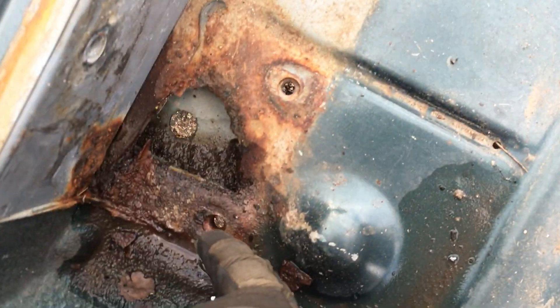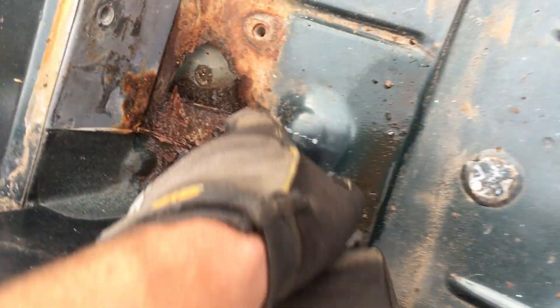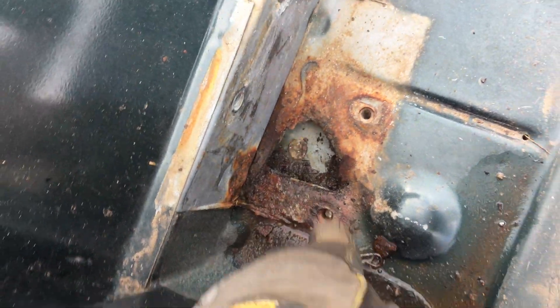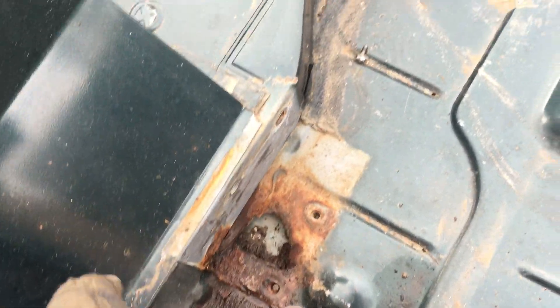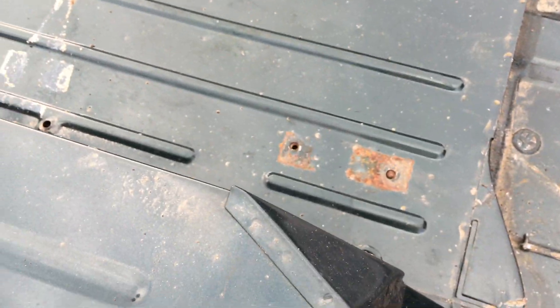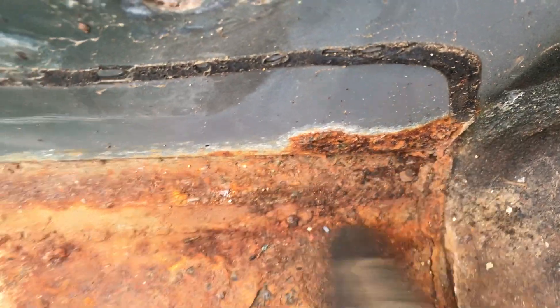Over there it's starting to eat, and I'll get closer. This side here, right underneath that roll cage — the roll cage was solid and the bolts all pulled out on this side. But underneath when we pulled it off, it does have a piece of steel down there that's nice and solid. But this piece I'd probably cut out — you don't need it, the roller covers it. The bolt hole there — you'll want to drill those out, those are your seat mounts. Coming back to the back side, this is nice and clean. Back through here is clean, and then you've got a surface area here again, just like the other side. Solid on the back.